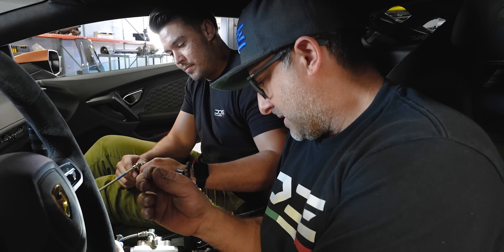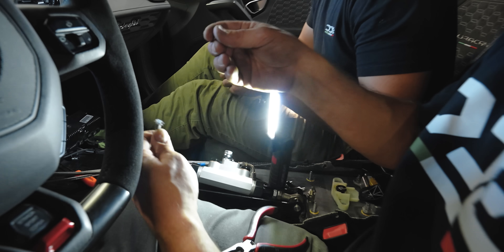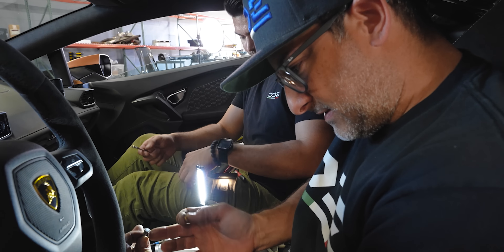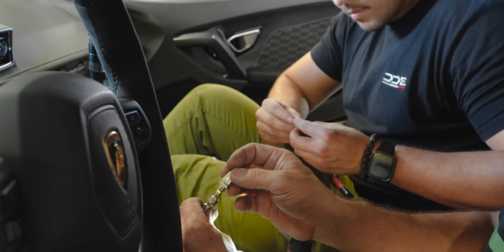We've got the lines in the car, all trimmed to length, and now we're assembling. It's kind of tedious and a pain to do inside the car, but necessary because the firewall hole is just big enough for these four lines to go through. Three are done and we've got the last one — tube nut, the nut, and the little acorn that smashes down. We flare it, get that on there, screw in the fitting, and we'll be good to go. We'll flush the lines out, spray brake cleaner and air through, blow them out, bolt it all together, bleed the brakes, and this thing's ready to rip. This is going to change the way this car drives — it's going to be a huge game changer. We also have a very special guest coming to look at the car.